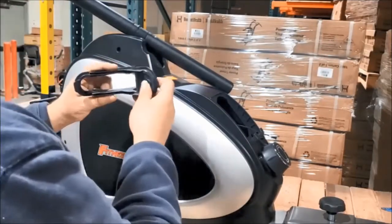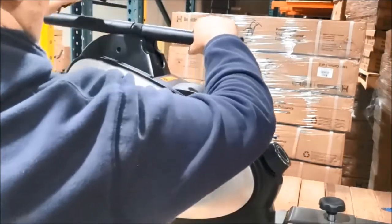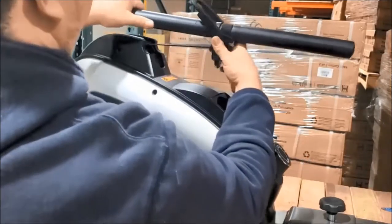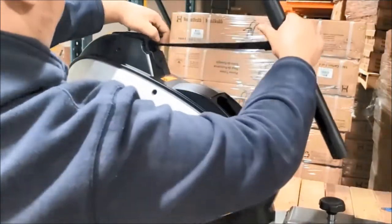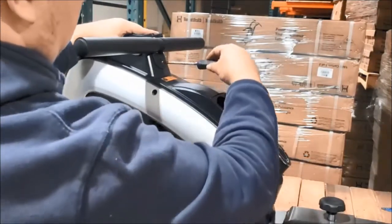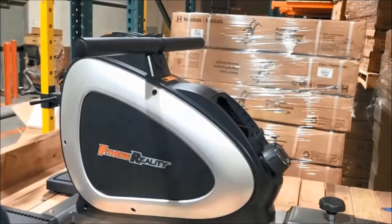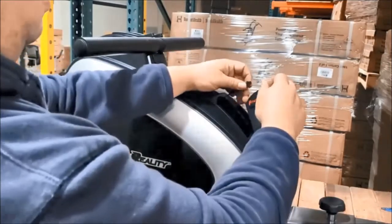Come in and reinstall this cover, then turn it over the handlebar and pull back on it. Once it clears, let it seat and put the screw back into place. Then reattach the console plugs.